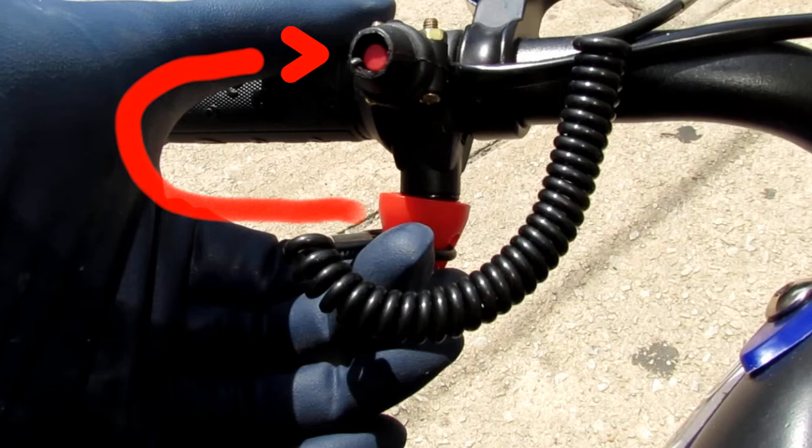At this point I'm very much in the wrong — that emergency kill switch is actually necessary. It needs to be placed at the very top, not at the bottom. This is going to keep the engine running; it needs to be in that top position for there to be spark. If you remove it, there'll be no spark, but I didn't know that — I would have known if I'd read the manual. So I'm saving you the time, and you'll see me make many mistakes trying to fix the no-spark situation.